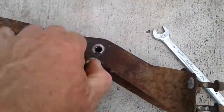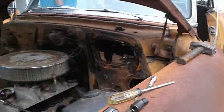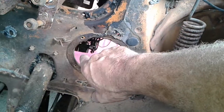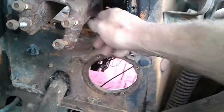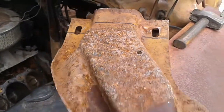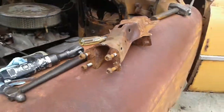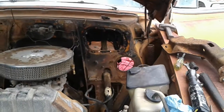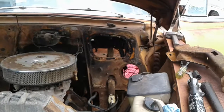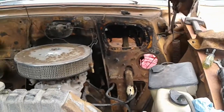What I've got to do now is get this up inside there — these holes are basically going to be down here and I'm going to have to weld this up, I already know that. It's also too long right now; I've already test-fitted it, so I'm going to lop a little bit off of that and keep moving it forward until I can get it coming back and figure out where I need to go. I am going to get disc brakes in the front, and I'm going to get the master cylinder and the power booster out here on the firewall instead of on the floor, so I can open up all that room down there.